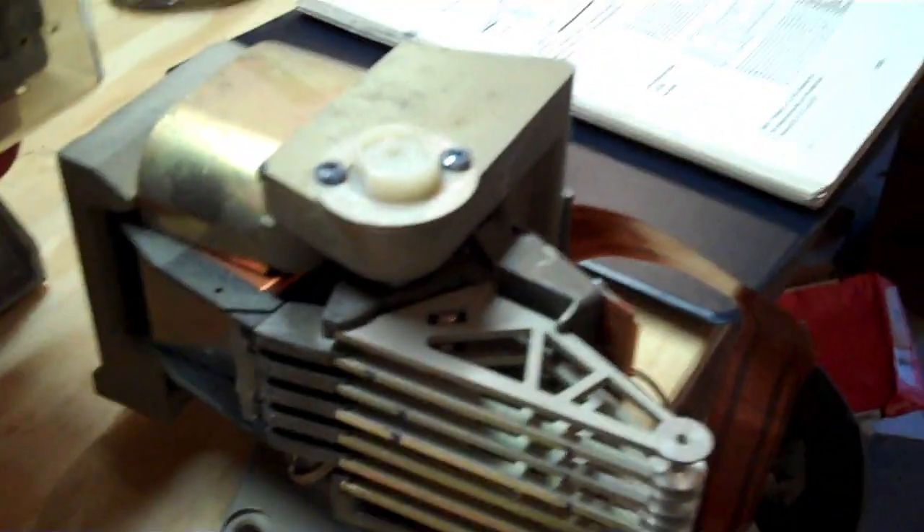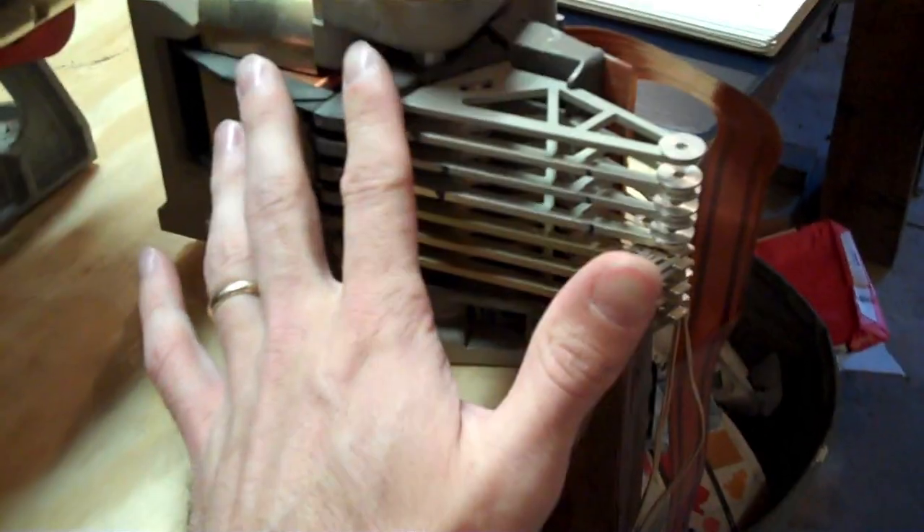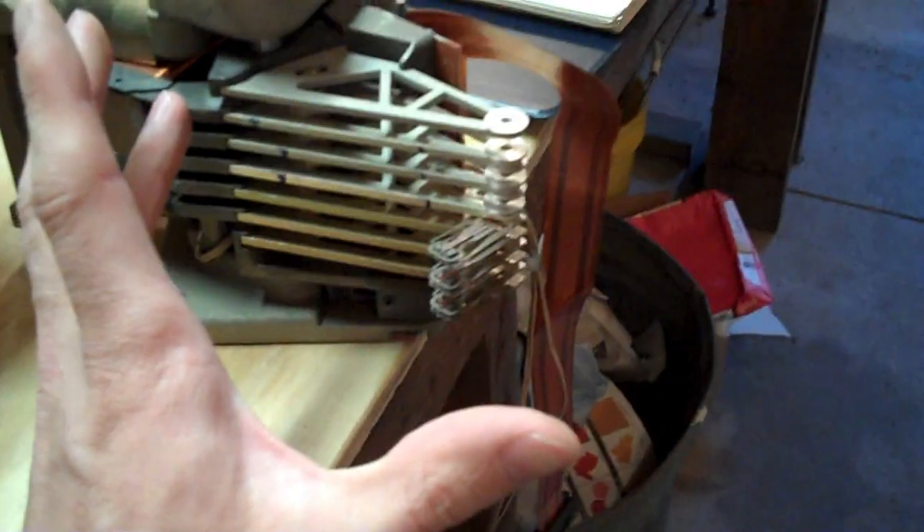This is the front of the unit. This little white lever here — you can just see there's a pedal — that is the head lock mechanism. This is the drive. I actually have another head mechanism here; this came from a hard drive similar to these from my IBM Series 1. Before I got the Series 1, somebody had taken the drive apart already, so nobody needs to get upset — I did not destroy a drive. The unit here only has head read mechanisms for three platters, so this was apparently a smaller drive. We've got these lovely micro ribbon cables here.